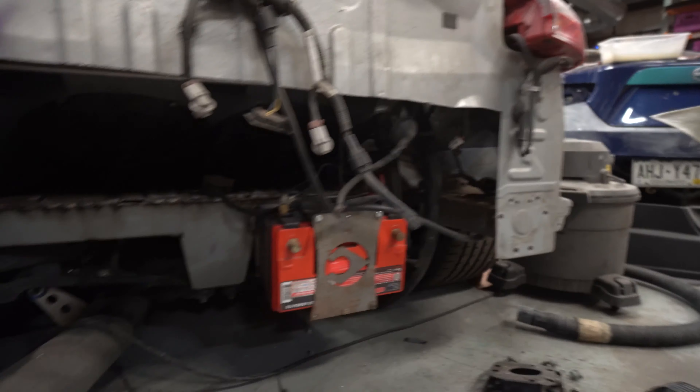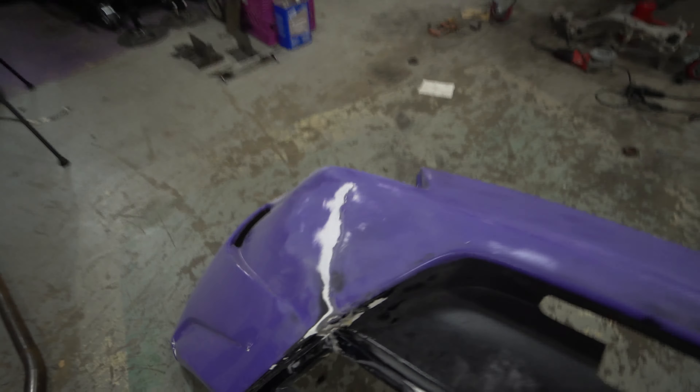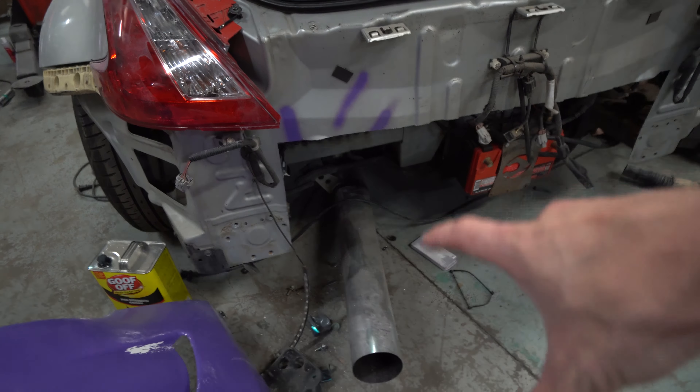I got this massive section cut out of the rear, so that'll help all the air from the radiator have a lot more room to flow out. I'm also going to tape up those factory holes — those little covers disappeared; I probably threw them away. And those slight little holes I'll just throw some 100 mile per hour tape on. Started getting the bumper worked out — it's all fiberglass packed together so it's all strong. Doing a bash bar with a jack point and all that fancy stuff. I may also do another muffler on the back of the exhaust, but that's to be determined.